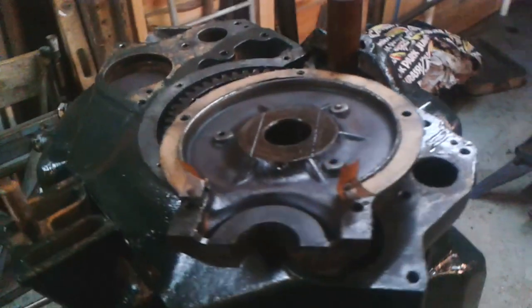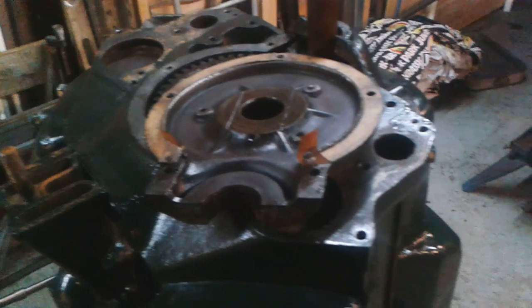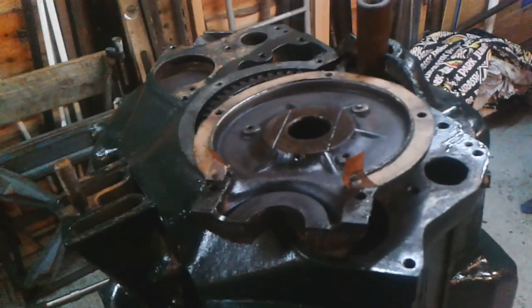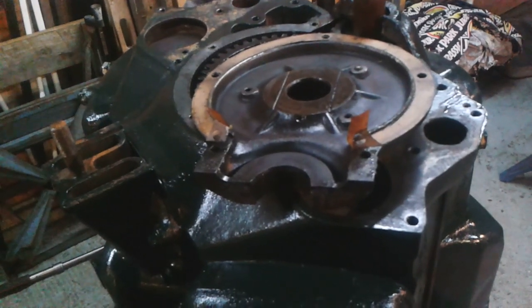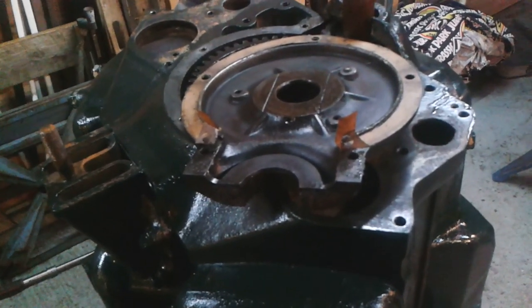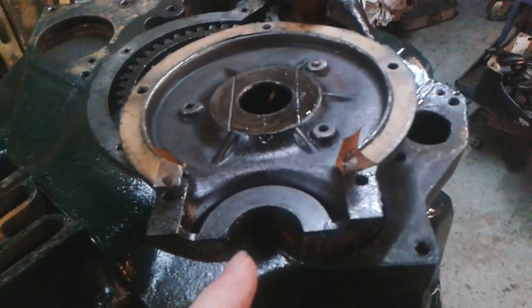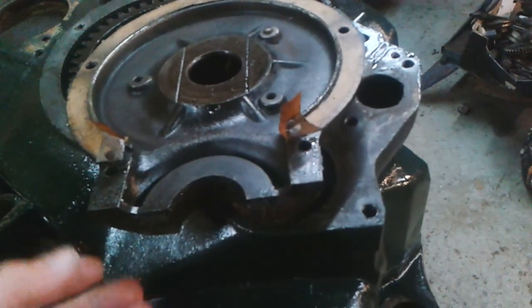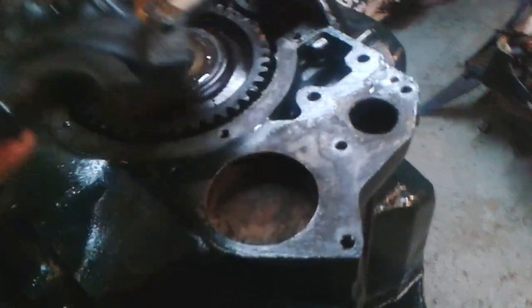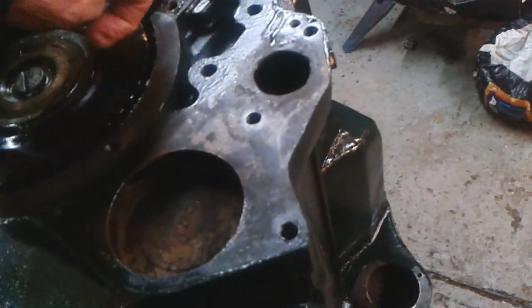Hello. Hello. Look at this. I put the video up showing me assembling this, and one of my eagle-eyed viewers very kindly wrote to me and said, "Mark, you're going to have a problem, because when you offered the timing cover in, the gasket folded back." What happened is that the gasket caught on there and folded under.